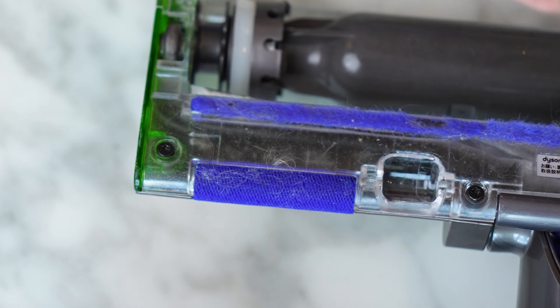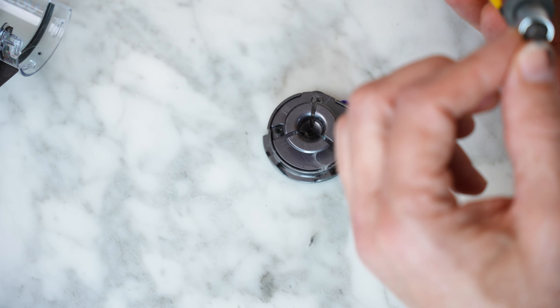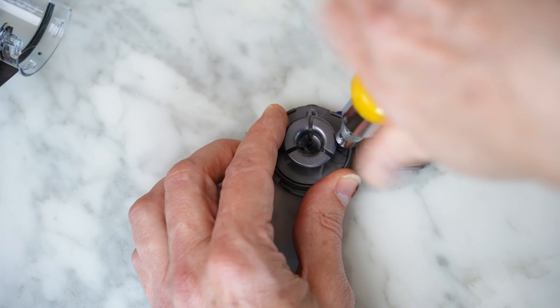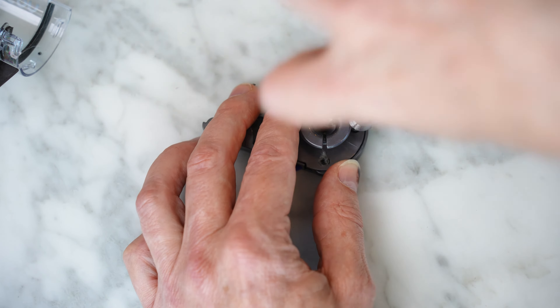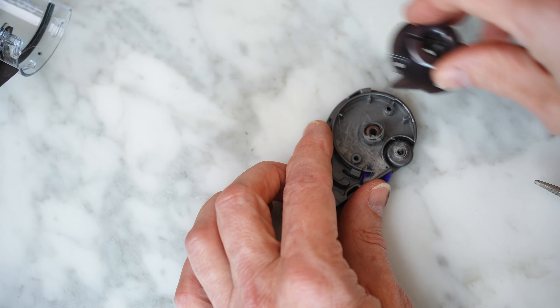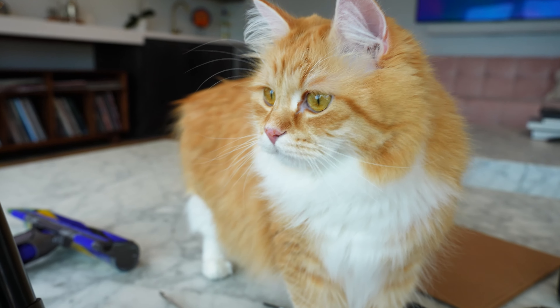Next, you might have hair stuck on one of the outer wheels. For that we're going to use the Torx T8 screwdriver — it has a star pattern to it. There are two screws; take them out. If you want, you can use a bigger screwdriver just to get in here and take this off. This comes off like this — you've got a bunch of hair in here. This is where the source of the hair is.